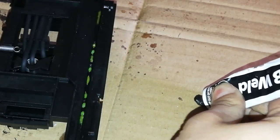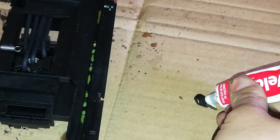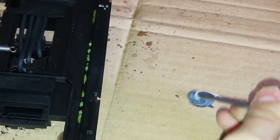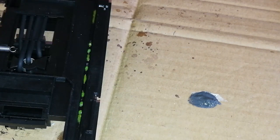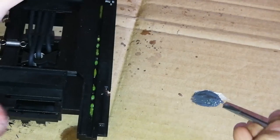Now I think it's pretty clean. We can take some JB Weld and mix it on the workbench — just a tiny bit, we don't need too much. I really love this stuff. I'm from Italy so we don't have JB Weld here, but I had to import it from the USA because this stuff is so good — it sticks so well to everything. What I want to do now is get a thin layer of JB Weld on that track, so that when the cleaning pad slides on this part it will rise just a tiny bit. I hope it will not jam — we'll see how this goes.